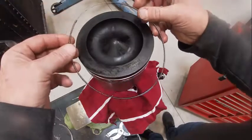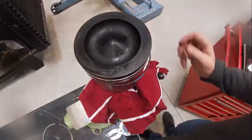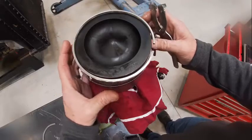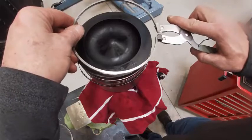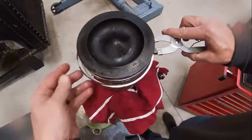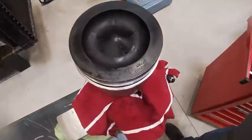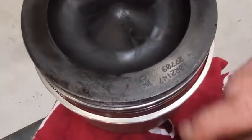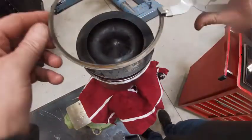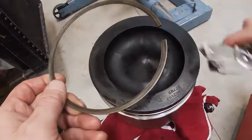We're going to go ahead and put our piston rings back on. There's a split — it's going to go over there. I'm going to take my oil control ring and I want to put this directly away from this split here. I'm going to push that together — got to make sure you get that ring inside of there. Make sure that expander is all the way inside of the ring. Try compressing it; make sure that it's nice and springy. You can see right here there's a part number on here — any time I see a part number, that's going to go to the top of the piston. So I'm going to take my scraper intermediate combination ring; this goes on next. Notice the lip, or the step, is going to go up.